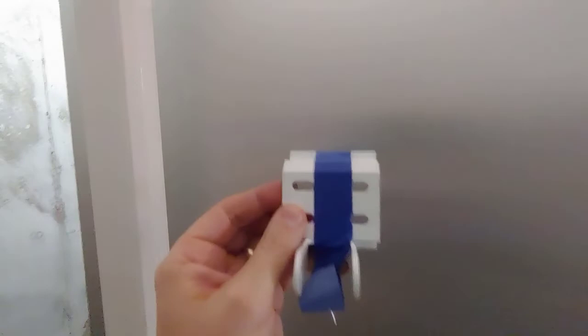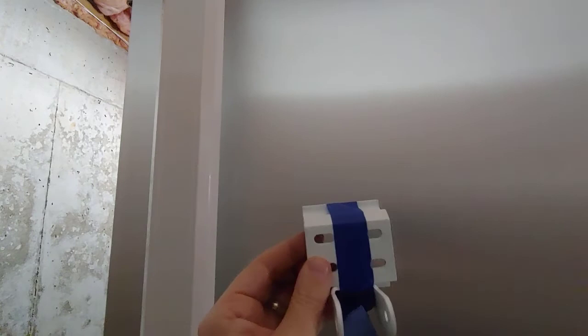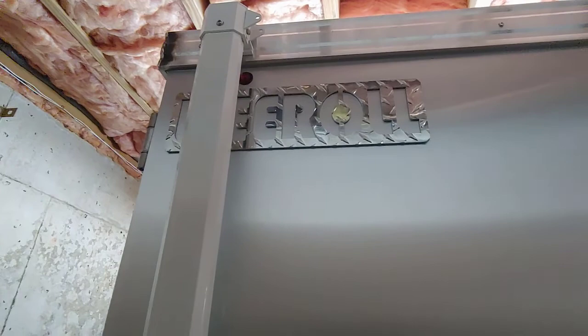This is the bottom bracket, and it attaches by, in my case, 2 self-tapping bolts to go right through this thick aluminum. You can go back and forth. Here's this bracket. See how wide those holes are? That means you can take this bracket and shift it that way, tap that in or out just a little bit. So you get like a quarter to a half an inch of adjustment left and right. So you've got to get your holes nearly exact like I did with those Sharpie marks, but then you'll have a little bit of adjustment, and that's good because you might need it.